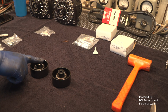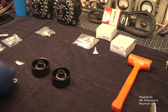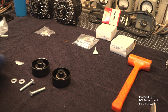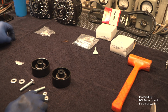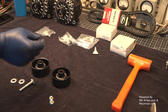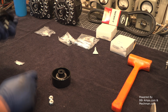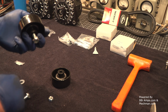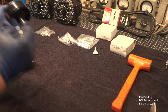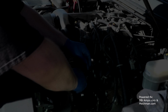Okay, so you are going to need the pulleys now. We're going to need the G spacers, the BF washers, the BD bolts, and 2 of the BG nylocks. Assuming these are going to be for the alternators when we get that far. So this goes through the front side of the plate. Washer, bolt, plate, nylock, washer, pulley, through the plate, nylock. Let's go put this on.